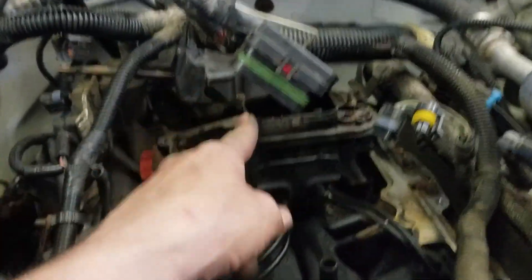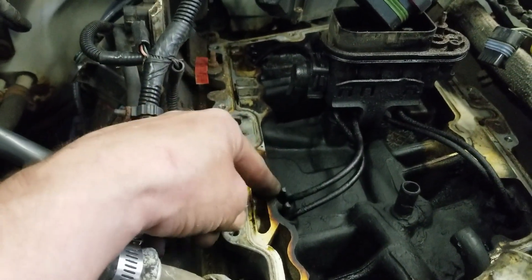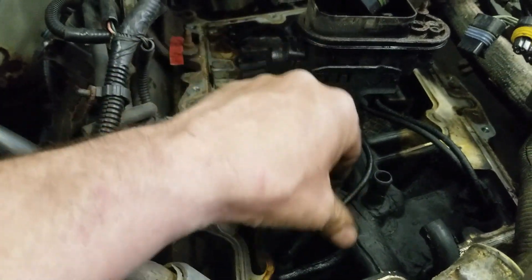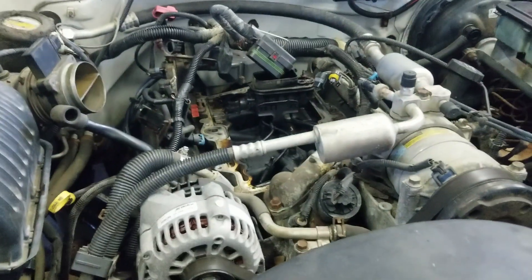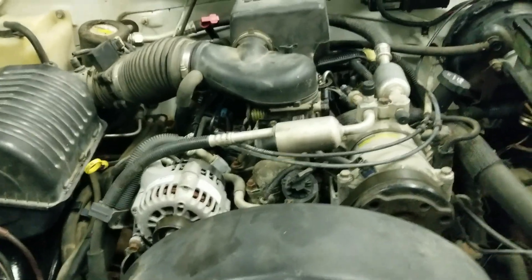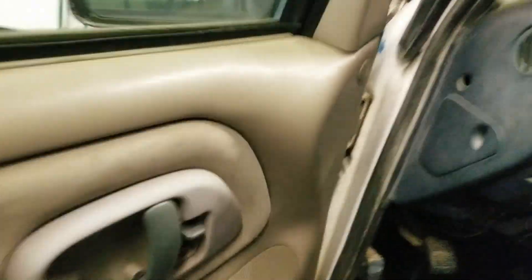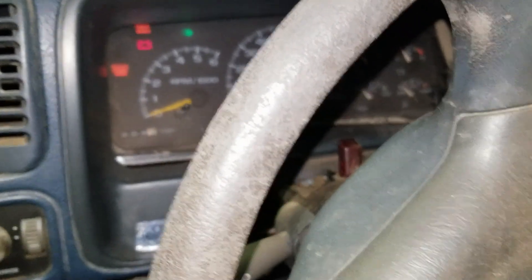With the upper intake manifold now removed, I have access to the injector assembly. I'm going to pull all of the injector tubes right out of the hole and swap out that injector housing. I got the intake all put back together — fuel lines are connected, plug wires, everything's put back on. I haven't started it yet — it should fire right up and hopefully the misfire is gone. Found the key. Here we go.